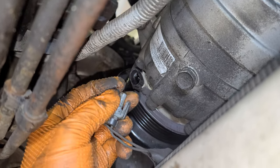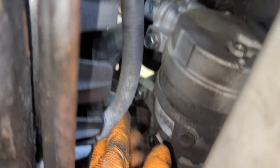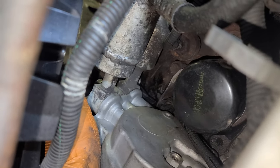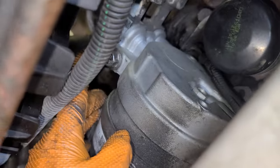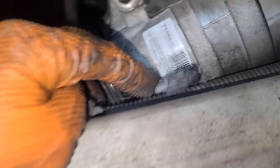Lift here, and there you go. All three are 15mm. The bolt is right there — you just gotta push it back and it'll come out. So I removed two bolts on top and one at the bottom, disconnected the connector, and the AC compressor drops out.